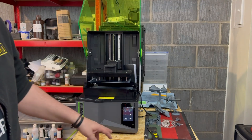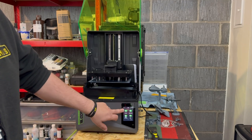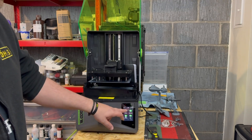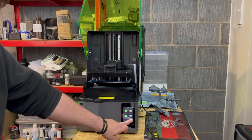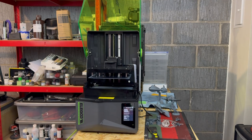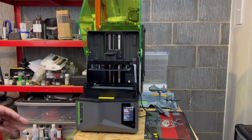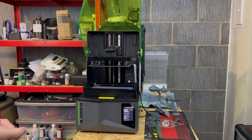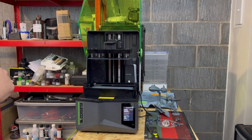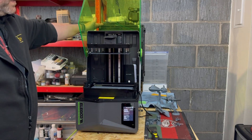The actual LCD settings themselves are pretty much the same as the Saturn 3, with the ability to move the Z axis arm up and down, carry out a tank clean, and do a calibration test which lights the screen up so you can see what's going on. You also have the function to carry out this new device self-test, which is very handy because it lets you know what's going on before you even attempt to print — spotting potential mechanical failures whether that be something jamming the Z axis, the screen not functioning properly, or a cable coming disconnected. This will run when you first turn the machine on, or when you tell it to.